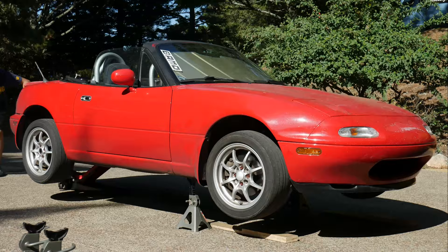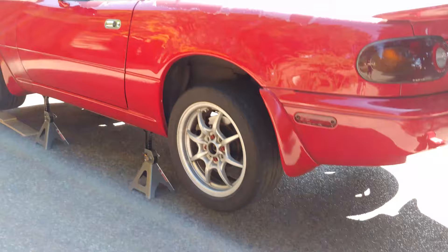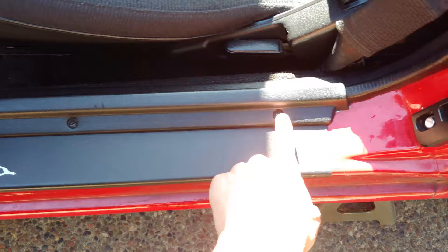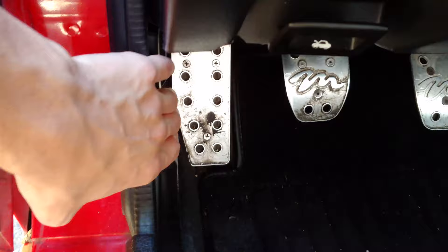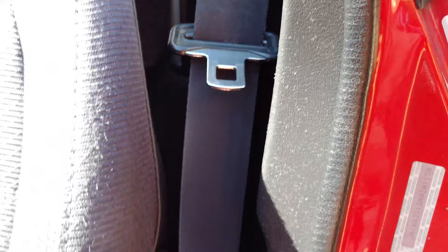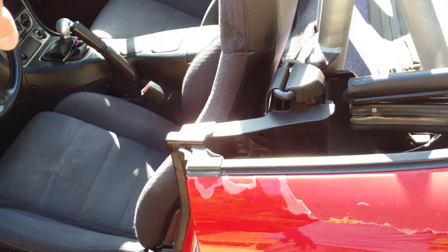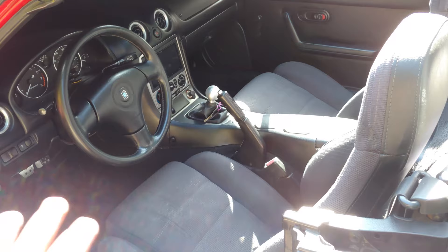The car's jacked up on all fours with plenty of room to work underneath. To access the carpet, we need to take out the seats on both sides, take out the door sills, remove four screws, and the kick panels under the dash. The seat belt fasteners have to come out too. Once that's out of the way, the carpet can be peeled up from the side and suspended over the center console with bungee cords to keep it away from the floor metal — that way when we're drilling from underneath to fit the frame rails, we don't drill through the carpet.